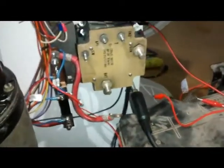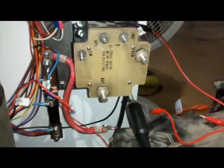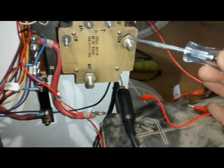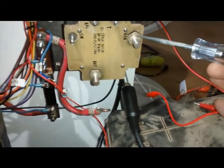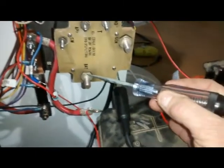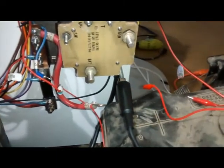We have all the wires disconnected from the reverse current contactor. This large terminal marked 'Generator' is obvious — it comes from the positive terminal from the generator directly; it's a large battery cable. Same down here, except this positive cable comes from the battery. The purpose of the relay is to connect the battery and the generator together, but more importantly to disconnect it when it needs to.